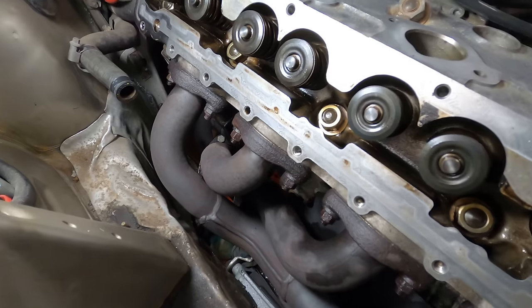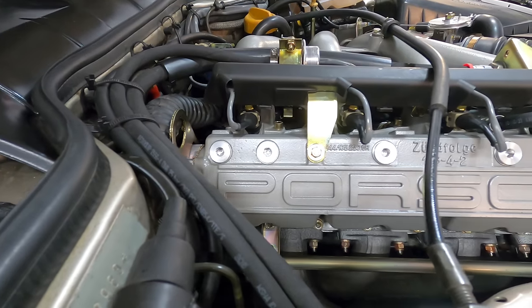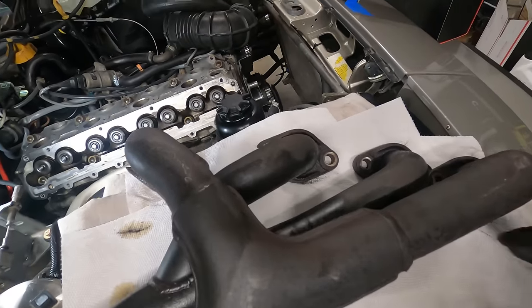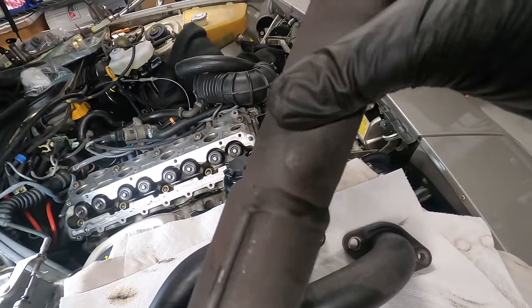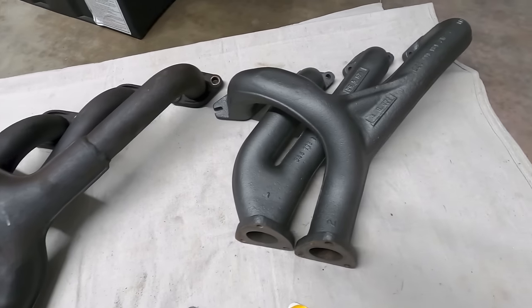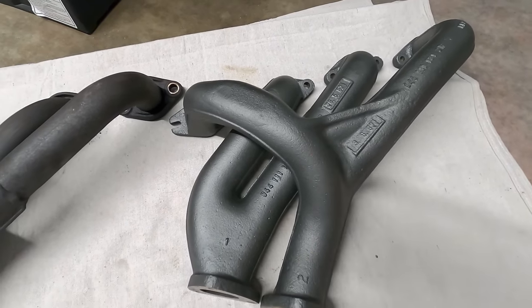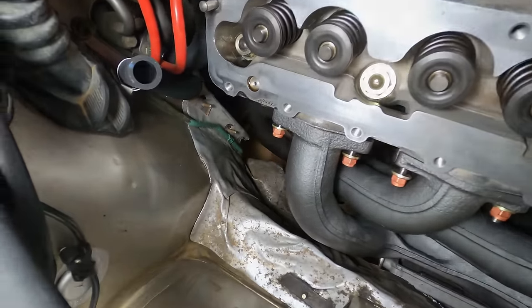Speaking of exhaust manifolds, you may have noticed that I've swapped out the later stainless steel manifolds on this car with a set of cast iron ones from an early car. As for overall weight, airflow, and heat dissipation, the stainless steel tubes are superior to the cast iron ones, but they're also notorious for developing cracks as they age, which is what happened on this car. Welding and repairing the steel tubes often results in further cracking, so the main benefit of the cast iron manifolds is reliability and longevity, as they essentially never crack. The tube material is a little thicker, which can cause some difficulty with wrench placement on the lower connections during installation, but once they're installed you won't have to worry about repeating this work due to future manifold failures.